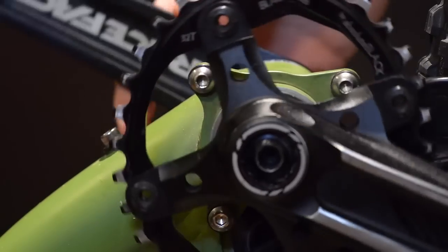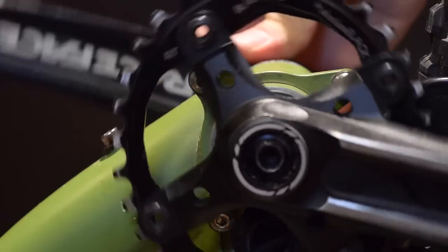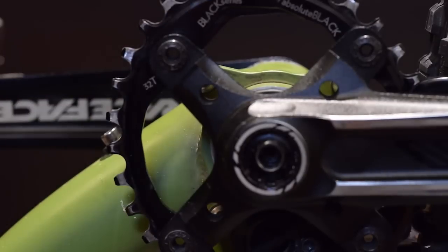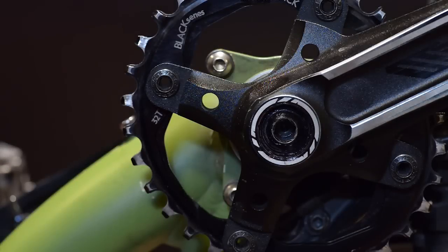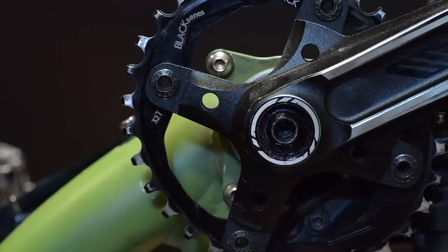Because this button bottoms out, there is no unnecessary side pressure on your bearings — on the bottom bracket bearings. And you're good to go. The final step here would be to reinstall your cap. Make sure you tighten this up so you don't lose it, for next time you need to remove the cranks, and you're pretty much done. Hope you guys found this useful. If you have any questions let me know below, and don't forget to like, subscribe, and keep an eye on my channel. I'll see you next time.